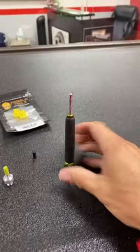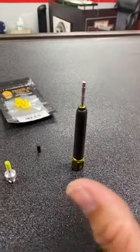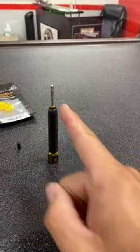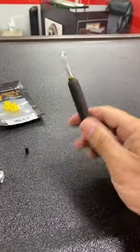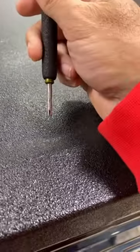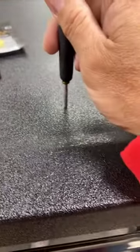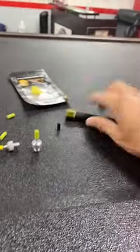Love this tool. I mean, it's a must have in any professional PDR technician's arsenal. Remember, you notice how I said professional, right? If you're a person that thinks, oh, I'm gonna get that because I'm gonna get into PDR because Mike Toledo said to get that, well, you be careful because you're gonna probably do more damage than not, okay? Because you really have to, tech tip, make sure it's completely level on the panel, okay? Not like this, not like that. Anyways, we'll get to that later.